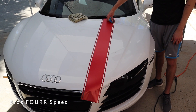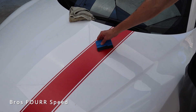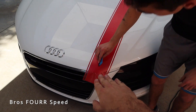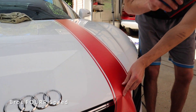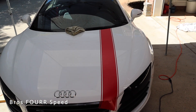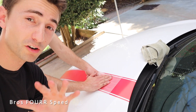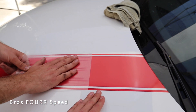Round two, and this is actually looking really good. Basically what we did is tack one side down while I held the other side off the paint, and Brian worked like you're vacuuming a rug — going about a half inch at a time, slowly pushing the vinyl down, doing a pass and then moving another half inch and going the other way. While he was doing that I was holding it from touching the paint, and we made it all the way to the edge of the hood with absolutely no bubbles. It's Oracle vinyl — name brand — just a little thinner than what we're used to. The protective layer is coming off really nicely; we're keeping a low angle so we're not putting any upward pressure.